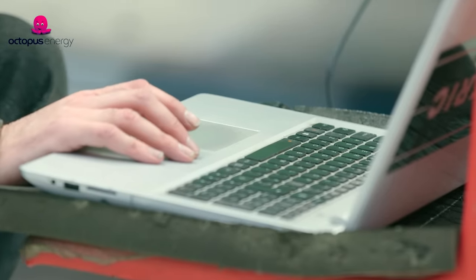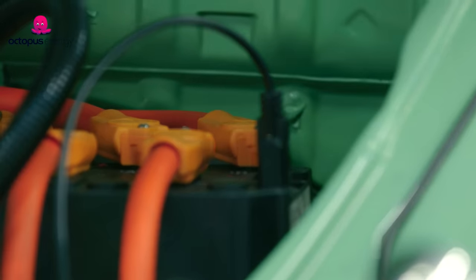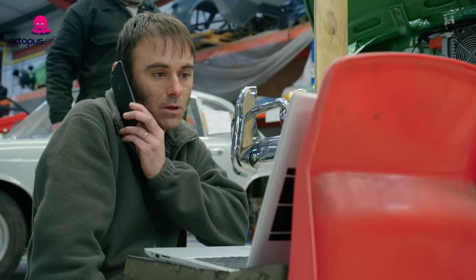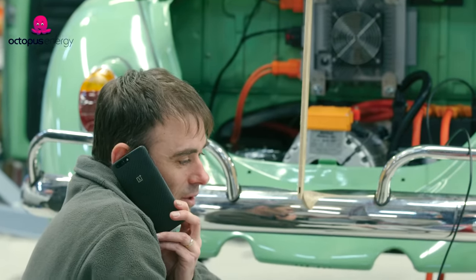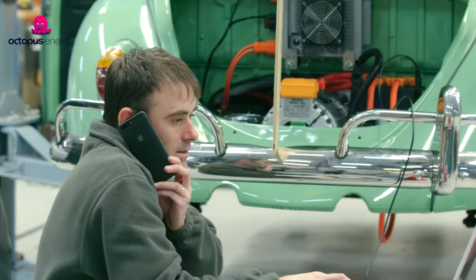Back into throttle — configure, traction, throttle. Map is 1,300 millivolts and the first point on the curve is 1,480, so it's a good way off. We've got a green thumbs up now. We've done that like three or four times — so in that case let me go to configure sensor.